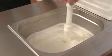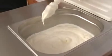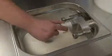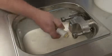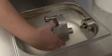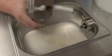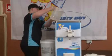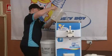Remove the lid and place the feeder tube into your bucket. In the case of a pump model, firstly remove the feeder tube and then the pump head. Add about 5 litres of cool, clean water to the hopper of the soft serve machine.